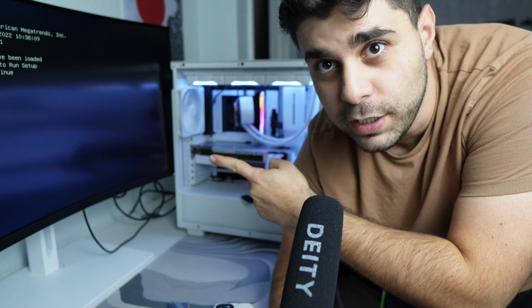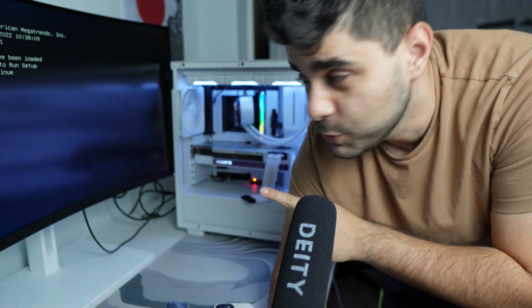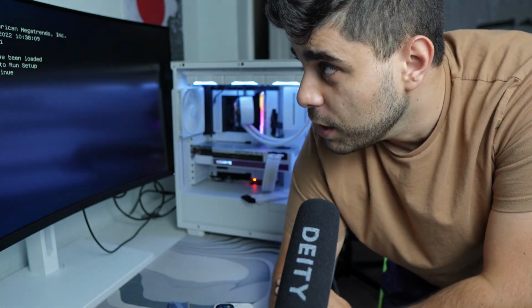So now is the last and final step, hopefully before I have to return the motherboard or the CPU. We are flashing the BIOS, upgrading to the latest version, hoping that will do something. So let's see what happens then. Do you see what's on the screen? There is hope. I just flashed the BIOS and it's booting up to the page.